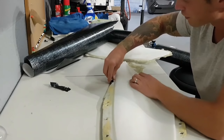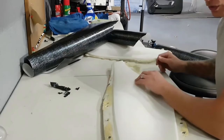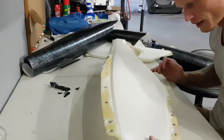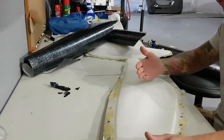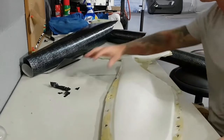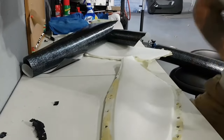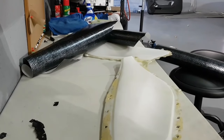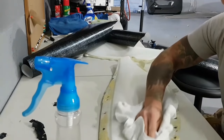This panel is the door panel and it was completely removed by the previous wrap shop, so they did a pretty good job of that. Looks like there was some light sanding going on here — I'm not sure if it was to make it smoother. This piece is much more rough than the other one, which is hence why it might have lifted. So we're going to lay into this recess so there's no strain and it doesn't lift. Let's do isopropyl alcohol and a clean rag — mist that and see what we can wipe off.